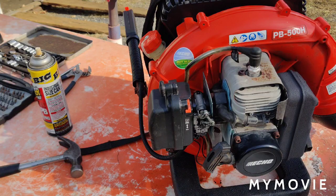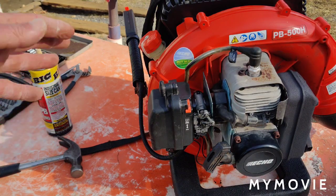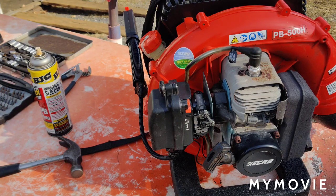It was bogging a little more before I started the camera back up. I'm going to see if the owner wants to take a $25 gamble and put a new carburetor on it. The fuel lines — I traced them down and they don't look collapsed. The fuel line out of the gas tank seemed to be in pretty good shape when I changed the fuel filter. I can't think of anything else it could be besides the carburetor. When I had the spark tester hooked up it did start bogging but still had good steady spark.